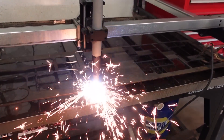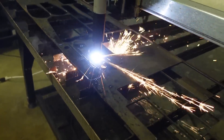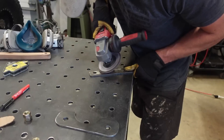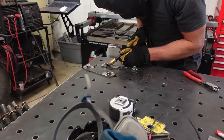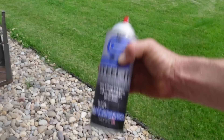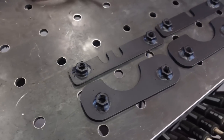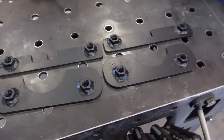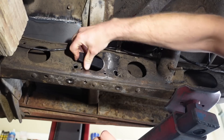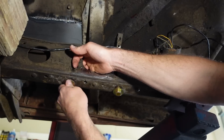There's been something bugging me about this crossmember — how I use the bolts going through the inside of the frame with the nuts on the inside of the frame. Every time I take it on or off it bugs me more. So I'm going to fix that right now. We are going to cut some plates out, weld some nuts to it, and then weld the plates on the inside of the frame. That way we don't have to mess around trying to stick our fingers inside of the frame — we'll have the nuts welded to the inside of the frame, making it so much easier to take the crossmember on and off.